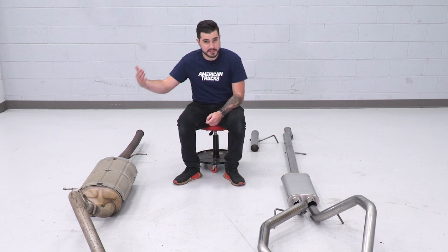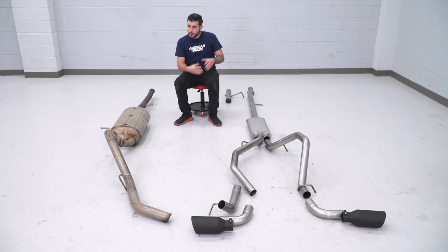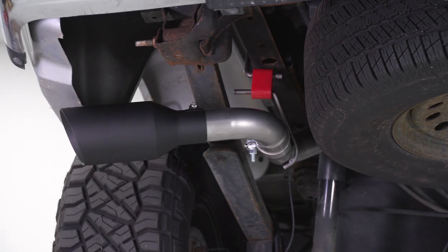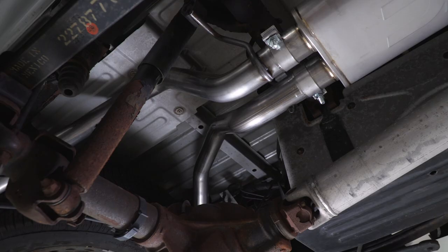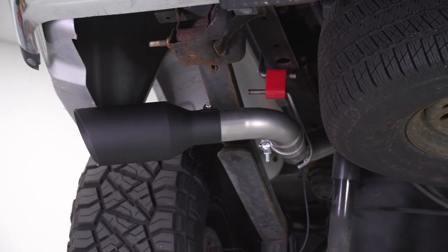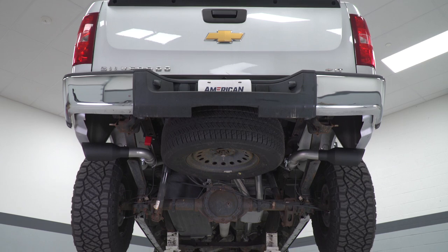Because we're going from single to dual, we do have to add another hanger to our driver's side because they didn't exist there before. Going back to that muffler — your factory one's got a lot of baffling on the inside, minimizing that V8 sound that you really wanna get out of your truck, whether it be a 5.3 or a 4.8. This Rough Country one is gonna be a little bit less baffled, more of a free-flowing, straight-through muffler to give you that increase in volume and aggression without having any of that drone you don't want inside the cabin. So it's gonna minimize that drone but give you that clear, crisp quality. Finally, the dual exhaust is gonna split out dual side exit — it's not gonna dump straight out of the rear bumper but to the side. You'll still have it dump out the passenger side rear tire but have the same thing now on the driver's side as well.